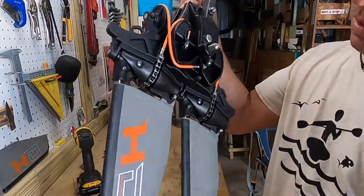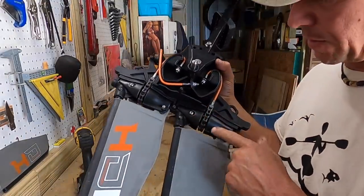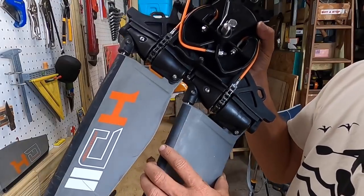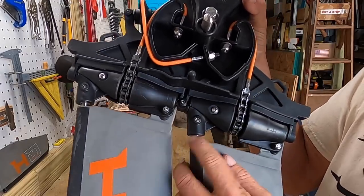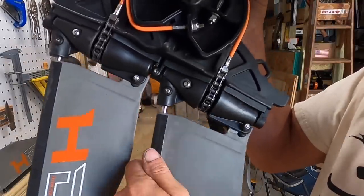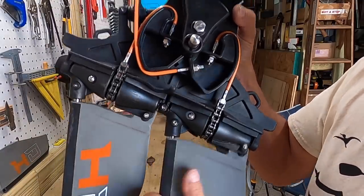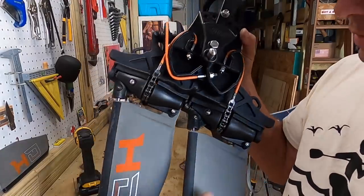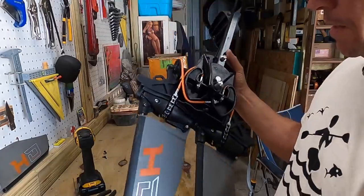There is one other thing and that has to do with the fins. Going back and forth like that — with everything else quieter you're going to notice these noises a little bit more, even though they're underwater and muffled a little by the sounds of the kayak cutting through the water. Here there's a space in between the housing and the fin, and you can see I can pull on it and it gets a little bit bigger. If you keep downward pressure on the fin as you go back and forth, not so much noise if it's up against it. You can put a spacer in there — that'll stretch this plastic a little bit away from the other piece of plastic it's hitting and make it a little quieter, as long as it doesn't impede the back-and-forth motion of the fin.